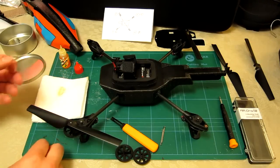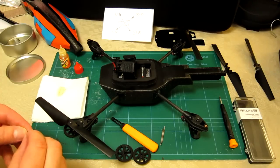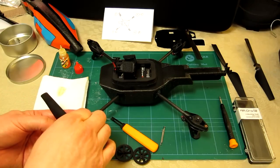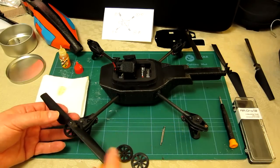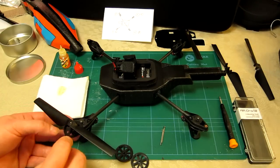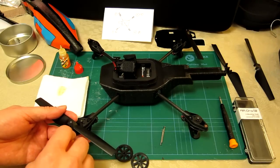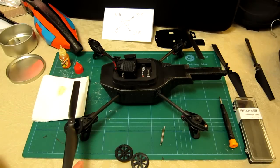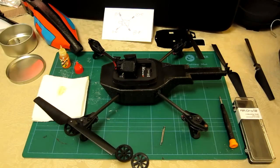I've decided to use a new blade and new circlip. Check the side — I find these have got a slightly flatter side and I like to have that side down to the blade. Getting that into position, then using the tool — make sure you've got it the right way up; there's a little recess that you can easily hold the pin in place. Make sure I've got this all at the right height and click that on in place. I'll give it a quick smooth with my finger, and I should be able to go around with a decent hard tap — about one revolution, not more, not less. It's not sticking at all, and that's exactly how it should feel.